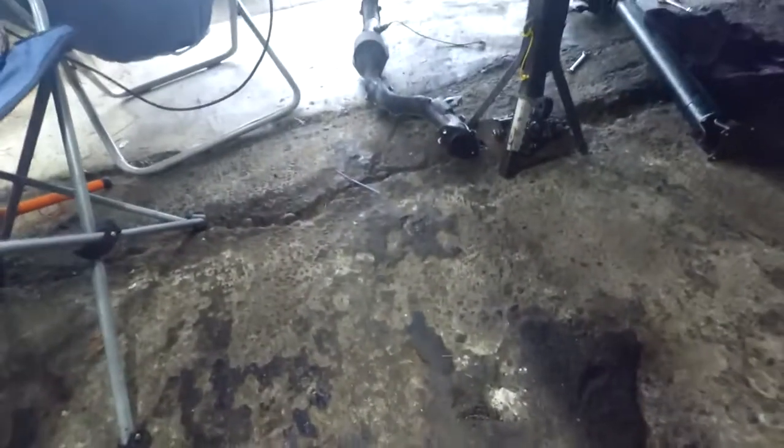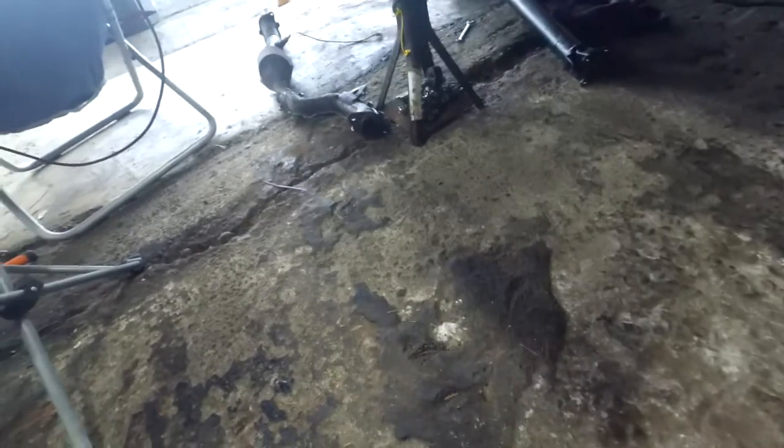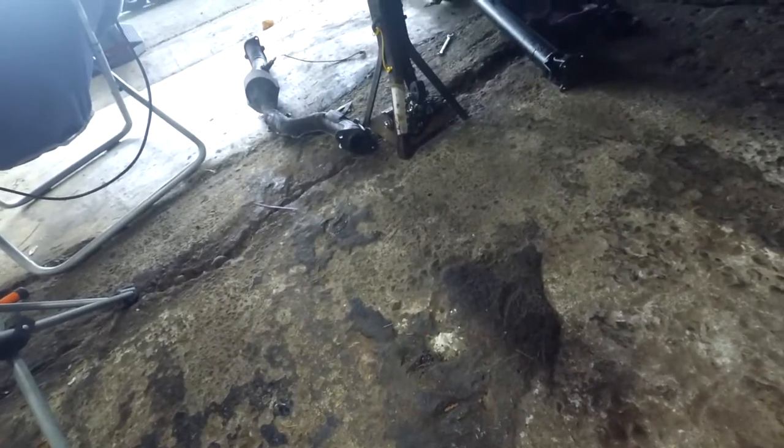Got the exhaust off. As you can see, it's got no resonator, no muffler. And then each bank — there's two ports there for the third cat, actually, because each bank has a cat. And then the driveline's off. So we just got to move that stuff out of the way, get the axles out, and then just the trans cooler hoses.